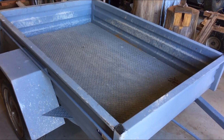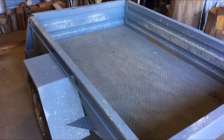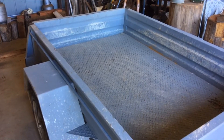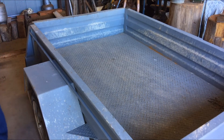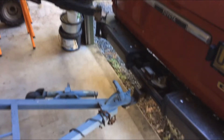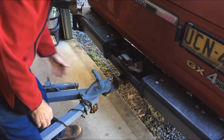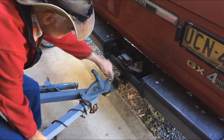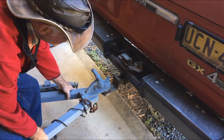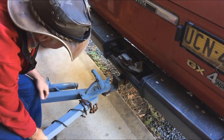It's a rattly trailer anyway, but it sounded like it was having other problems. The tailgate makes a bit of noise, and if you look down here at the tow hitch, you can see I get a bit of rattle in here. I've also got a fair bit of movement on the ball itself. I can't do much about this one, but I can tighten up this adjustment here a little bit.